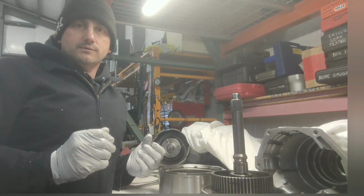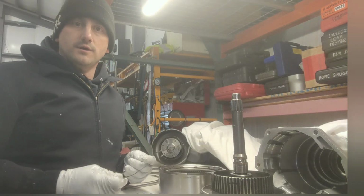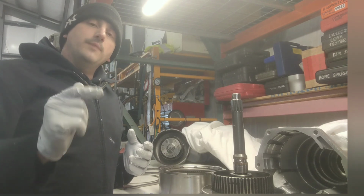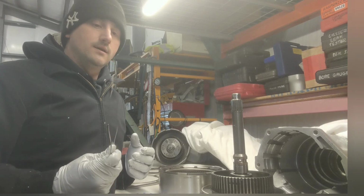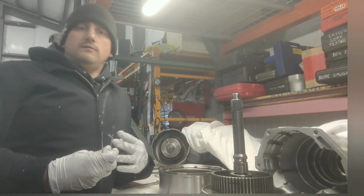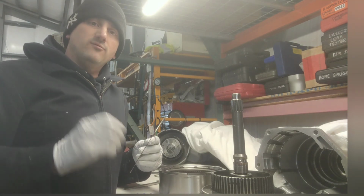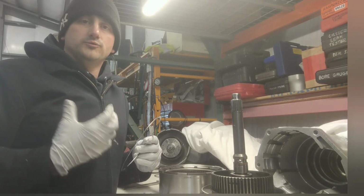if you ride motorcycles, and I'll explain this for car drivers, you've all heard of a friction zone. That is the part of the clutch where you let it out, where you can smoothly engage the clutch. Now, when you go to a performance clutch pack, they say get rid of that wavy snap ring, that wavy metal, and they give you a flat steel, so you can put an extra friction in there and gain that clamping force. Because the more frictions you have, the more surface area, the more ability to hold torque you have.